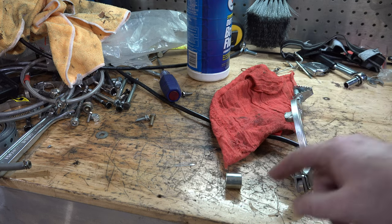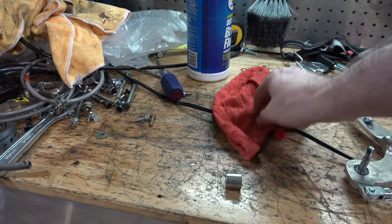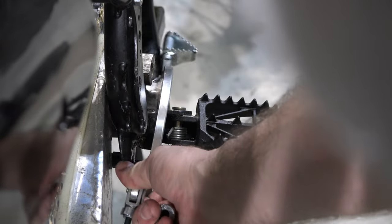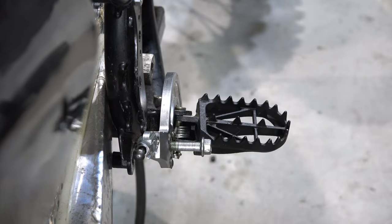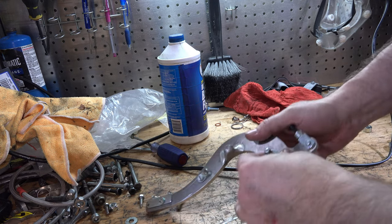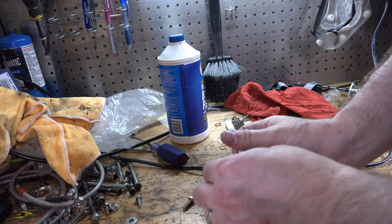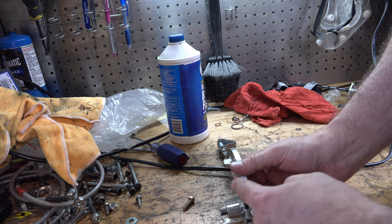The problem is I need to push this in more, so this needs to be shorter and I need a washer in front of it. I also have to be careful that this gets really close to the nut on the swing arm. You can see you scrape up against this at some point, but you need this to be in the center. Whenever we have this on, it's going to push against that bearing and it won't be able to spin. But if I put a big washer in there, it's able to spin without being hung up. The other problem is that this ends up being off-center, lining up with the side of the rear master cylinder and getting hung up.